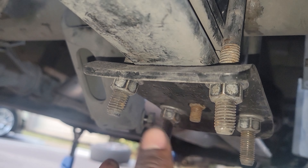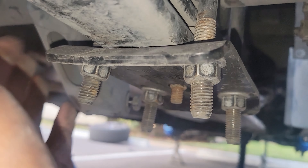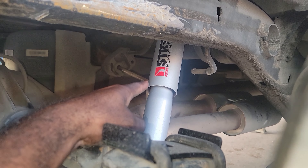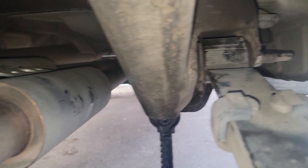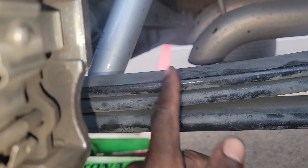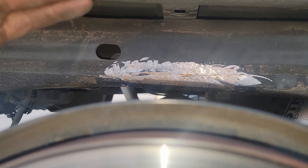This is the new bottom piece. Usually the holder for the leaf spring was this weird little shape thing — we had to use the new part instead. That's the new part for the hangers to hang in. And then there's the shorter drop shock. That thing does not want to extend at all — you basically had to put a jack on it and then slide it in the hole. We had to disconnect it down there to get the whole thing out, then flip the bolt and put C-clamps on here to hold it down. Grinding those parts off is what took the most time.